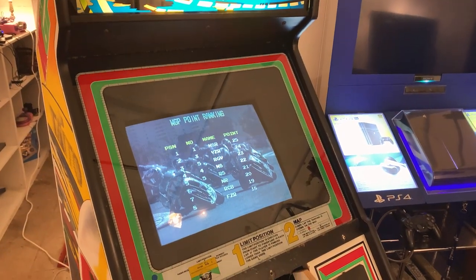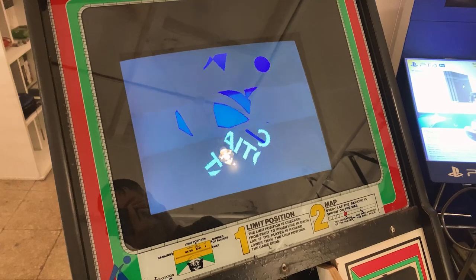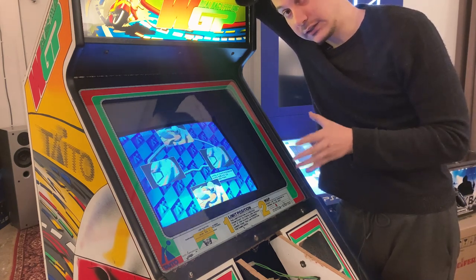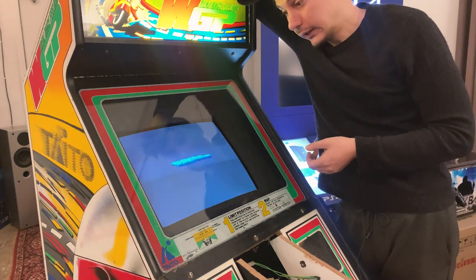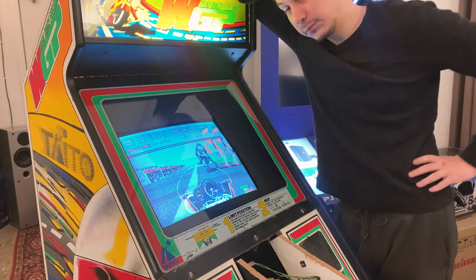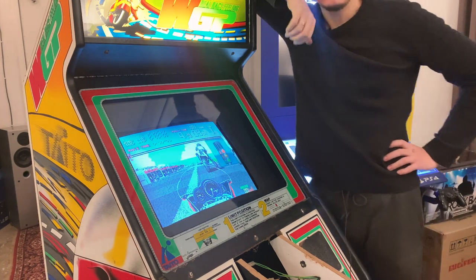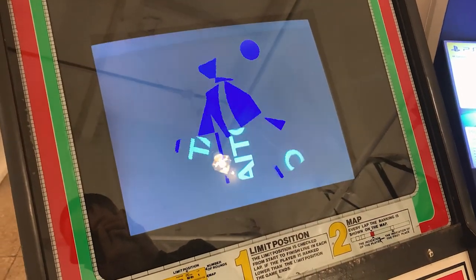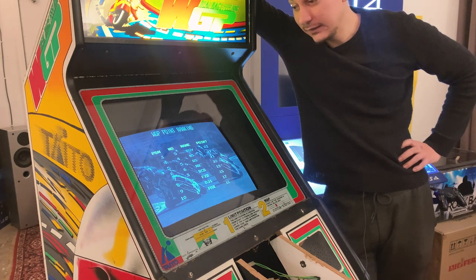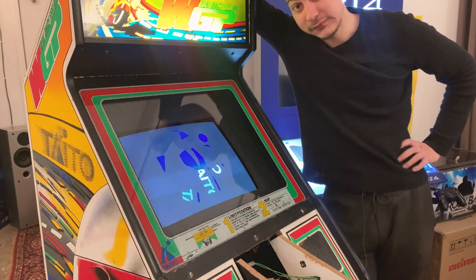Of course it's much easier to use a flat panel, but for this project and this arcade we just wanted to try something more complicated. I don't know if I will want to do it again. Old CRTs are growing in price, but you can find them relatively cheap — this one we got for free. The conversion board is 17 to 18 euros, and voila, we have image. The arcade will be used in the museum — we'll work a bit with the controls and many families will be happy. So those are my tips: low-cost repair of arcades can be quite cheap. Maybe it's not the best solution, but it works. And of course it's a great solution if you want to build your own arcade. Till next time.